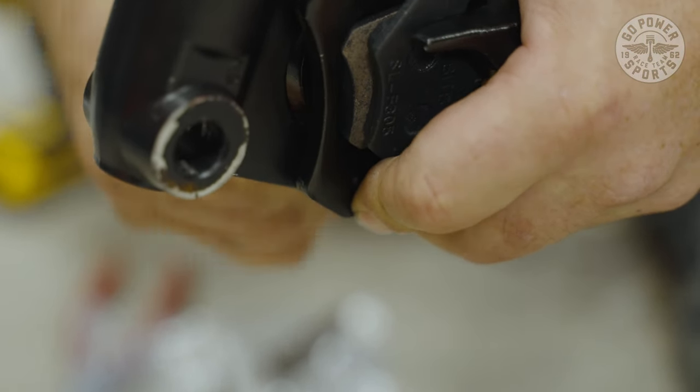Now we're going to oil it up and fuel it up and take a test ride. First, we're going to come down here, remove our oil cap, and fill the oil up to the bottom of the threads. Here we are using Pennzoil 10W30. You need a name brand type of oil, whether it be Motorcraft, Havoline, Castrol, Pennzoil. Got a long funnel, nice clean rags to keep down there so I'm not making a mess everywhere.